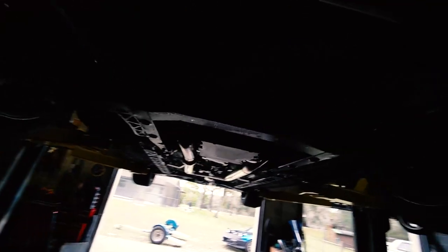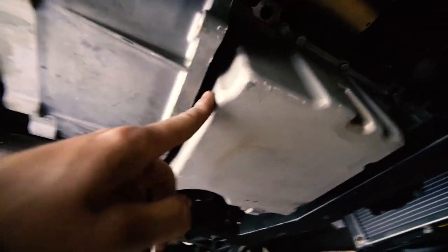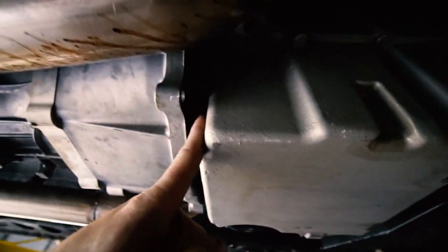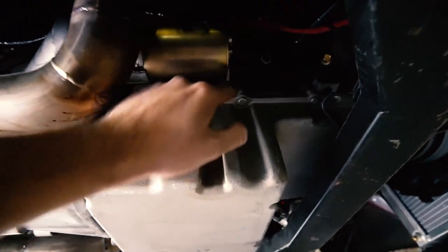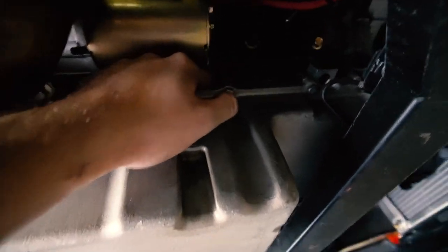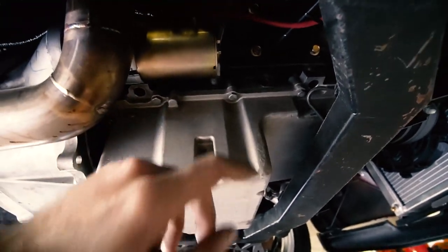Update on the oil thing. These back Allen bolts seem to be weeping, and I think I just need to thread seal them because I don't think there's an O-ring around the gasket in that spot. Thing number two — it's absolutely leaking out of the dipstick. This is an aftermarket dipstick, the braided kind like a diesel truck. And the third thing: when I was reading online last night, it appears that dipstick is way too high.